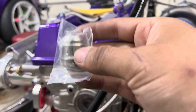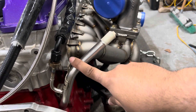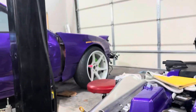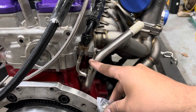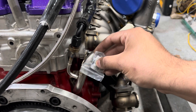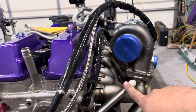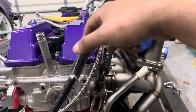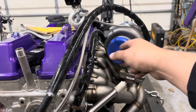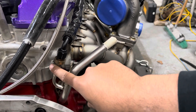What we're going to do is loop these with the back of the head and loop it to the heater core line, since I'm not running a heater on this car and never have. So I'm just going to cut it around here and weld it straight to this. My original plan was to run my cooling lines for the turbo out of this, but that would have choked the head from flowing enough since I was going from a 10AN down to a 6AN for the turbo lines.